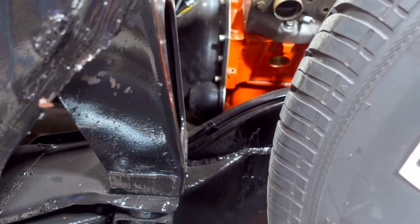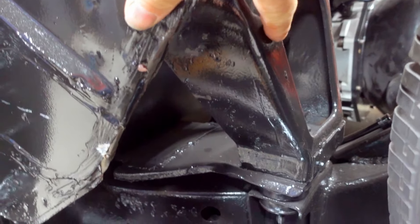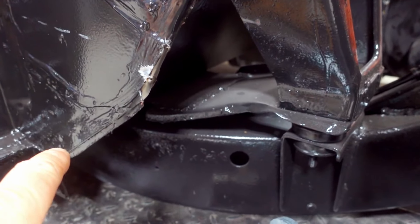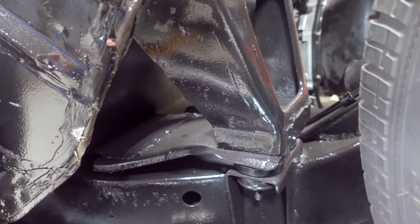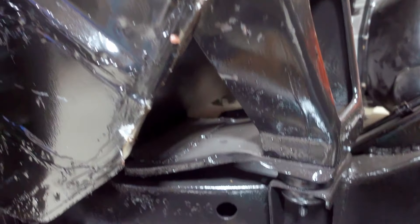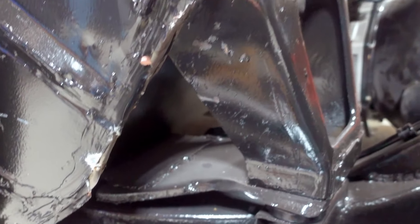When my tires turn all the way, I've got to get through here. What I'm going to have to do is cut - Zach's going to hate this - I'm going to cut this side of the mount off. Technically I already put bigger mounts right underneath over here, so the floor is supported. There's a second one basically just holding the firewall up, and the way I did the tunnel this brace really isn't doing much now. So I'm just going to cut it out and let future Ricky worry about that.